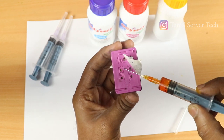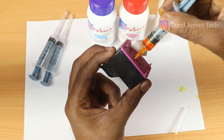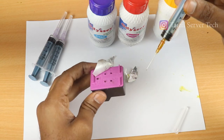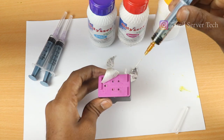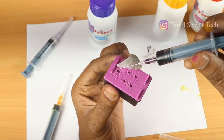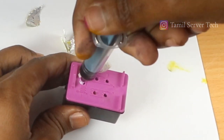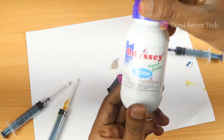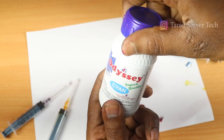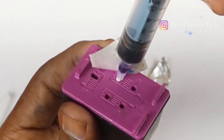So let's take care of it. First, there are five dots on the bottom of the cartridge. Now let's try this. I'm going to take a piece of paper and place it under the cartridge. The top hole is right there. Let's inject the same color — I'm going to inject the magenta. If you put the syringe in the top hole, you can inject it. Next is cyan — it's a very balanced cyan color. Open it and inject it on the right side. You can inject it in the top, you can see it correctly.